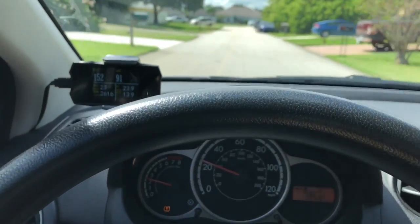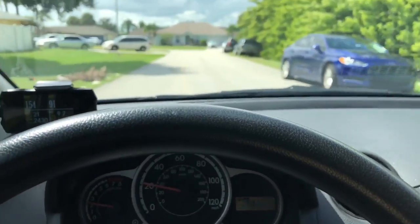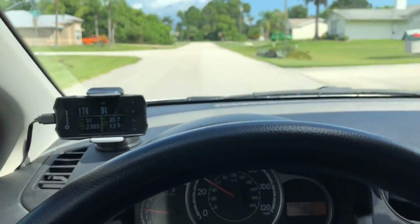Out on the road the brake pedal is firmer and brake engagement is more immediate — quite the difference for just a little bit of adjustment. This is a pretty simple job, especially if you're experienced, and I don't think it's impossible for someone newer to working on their own car. The limiting factor is really access to tools — I needed a drill, hammers, screwdrivers, and things like that just to get those screws out of the drums that don't even need to be there. Yes, there is an adjuster on the handbrake handle you could adjust, but that's really not the right way. As you saw here, there are more benefits to taking the drums off and working on the drum brake assembly than just adjusting that little nut on the handbrake handle and band-aiding the problem.